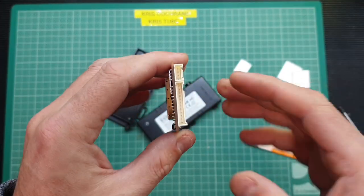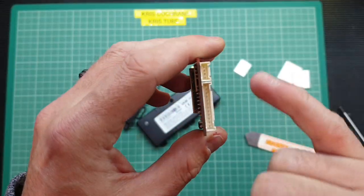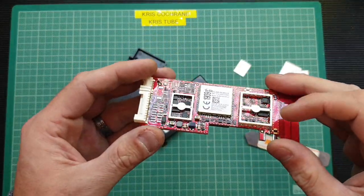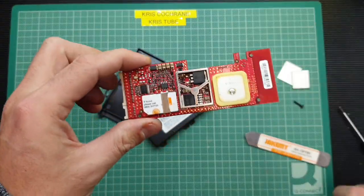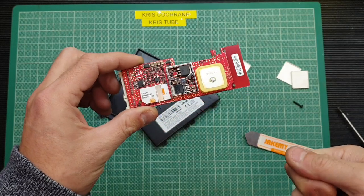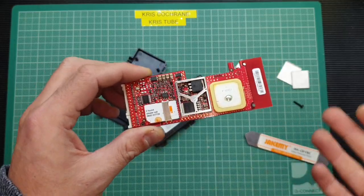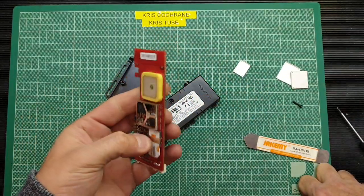There look like a lot of connections here, but I didn't get a cable with this. However, looking at the installation manual from Redtail themselves, only 3 wires are required: a ground, plus 12 volts (or 13.8 volts, whatever it is on the vehicle), and an ignition sense. If the ignition is off, there's 0 volts on the ignition sense line, meaning it's just sitting dormant — I'd imagine it updates its position maybe once every 5 minutes or so. However, once you turn the ignition on and the device senses 12 or 13.8 volts coming in, that's when it fires up the sensor suite and starts monitoring driver behaviour.